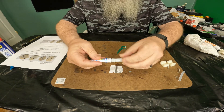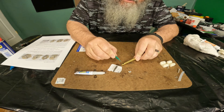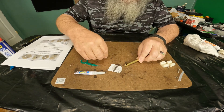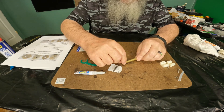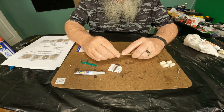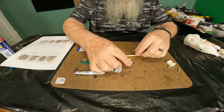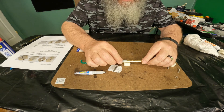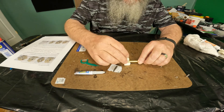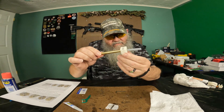Here's where the rubber meets the road. I'm going to take a bit of super glue on this little toothpick and slide just a little of it on the window — try to keep it on the outside of the window, you don't want it in the window. Then I take the patch and slide it in place. Let's put our tube with silicone grease on it and slide it into the barrel. You'll notice the gluing vise has a little detent — your window with the patch goes into that detent. Then we slide the gluing vise together and tighten it down. The tubing is inside the barrel, it's all set into the vise, the patch is glued into place, and the vise is tightened down.